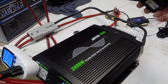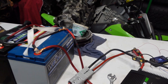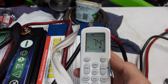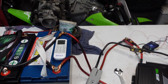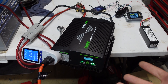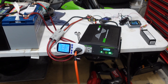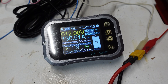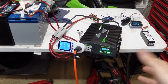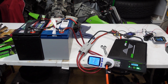Fan noise is personal preference — some people hate it, some don't mind it, it depends on where you have your inverter set up. Now I'm going to crank the mini split all the way up to the strong setting to stress test it one more time. Even at 1300 watts the fans just kicked off — that tells me it's temperature-based, not load-based. Personally I'd prefer load-based fan ramping, but this works fine. We're now pulling 1500 watts in and 1400 watts out. The system is not breaking a sweat. Even for this cheap budget system, it's very capable of powering an AC unit.